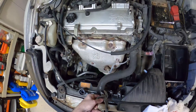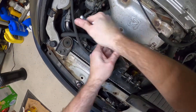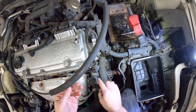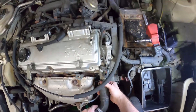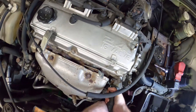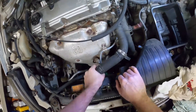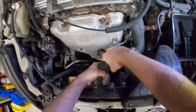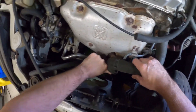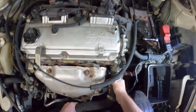While that's draining, I'm going to go ahead and remove the clamps on the upper radiator hose. You should have no doubt that it's going to make a mess. Grab them and twist. This one is plastic — be careful. These things just eat you up. I told you we'd make a mess. Look at all that corrosion.